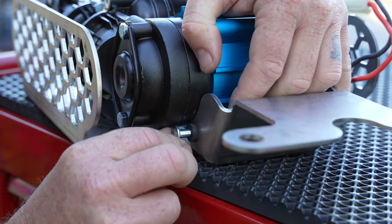Next part of this install is putting the air tank in. This is the ARB four litre air tank - the new design with your fittings at the bottom, top, wherever you want to have them. The beauty about this is you want to mount it so your fittings are at the bottom for two reasons: easy to run fittings out, and you can put an air drain on there because this fills up with water. When it fills up with water you just pull it and all the water comes out - it's not water slopping around forever. This is a beautiful thing about this new design.